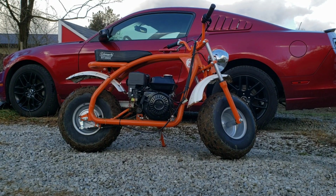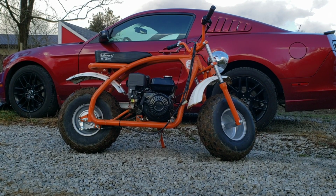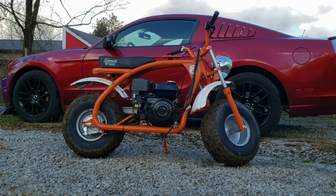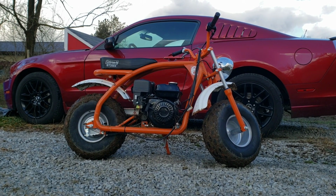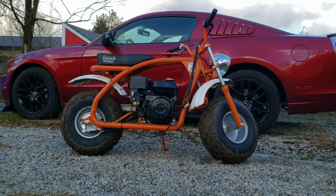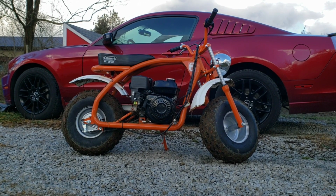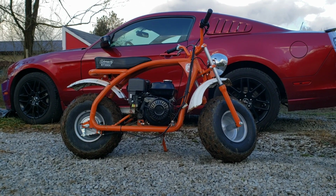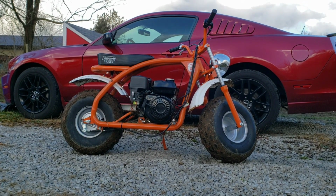So like I said, I have plans for these. We're going to be removing the throttle stops on them, removing the governors. We're going to be installing the belt drive CVT torque converter on at least one of them. I'm going to be modifying the springs on another with the clutch so that it'll engage at a later RPM. We'll be doing a stage 1 and stage 2 performance packages, possibly even building one of the motors from the inside out. Eventually a Predator 212 swap to compare.